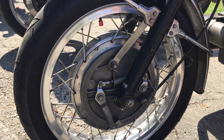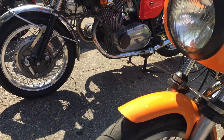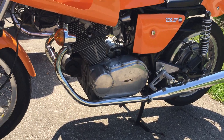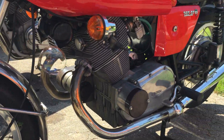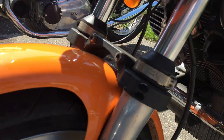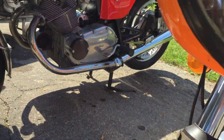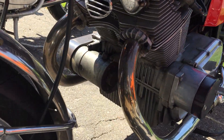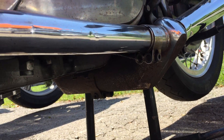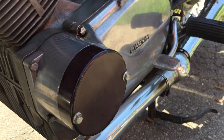The next way you can tell is with the exhaust balance pipes. This has the LaFranconi exhausts on it — you can see the shape — and the 73 has the Conti exhausts. On the 72, the balance pipe between the exhausts is up front. On the 73, there isn't a balance pipe up there; it goes underneath the engine from the very middle back, and that affects ground clearance.